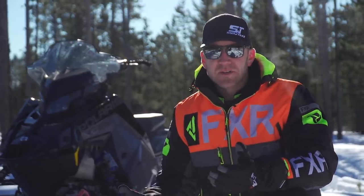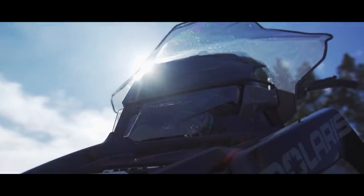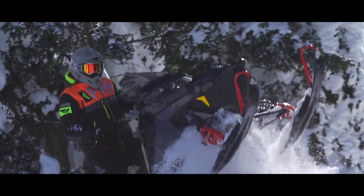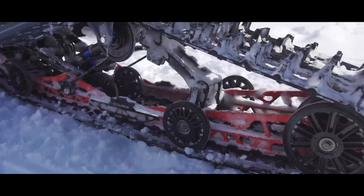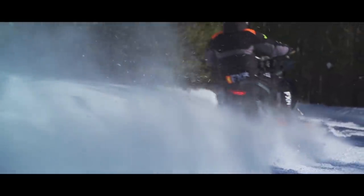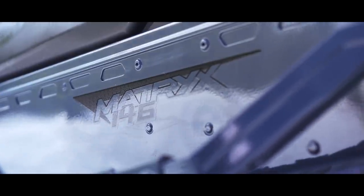So what stayed the same and what's changed? The new Switchback Assault in the Matrix chassis does look quite a bit different, but it still has that hallmark Switchback Assault DNA. With there still being an 850 Switchback Assault in the 144-inch length, what are you benefiting from going to this new length? The rear IGX skid frame is nearly identical, except for a bit of extra length and some rail stiffeners, so you're still getting the hallmark Switchback Assault style rear compliance. But with the extra two inches of track length, you actually benefit from a reduction in weight. Because of the pitch on the track, it ends up tipping the scales below the 144-inch Switchback Assault, resulting in saved weight while increasing flotation.